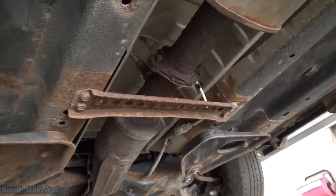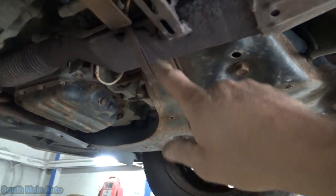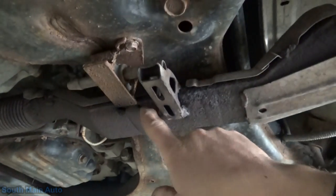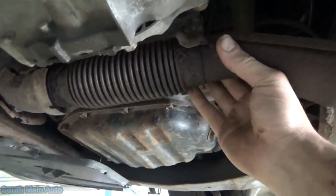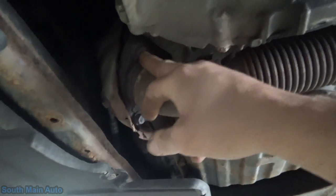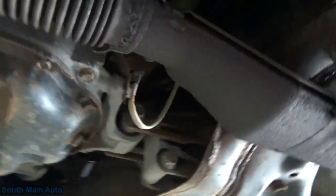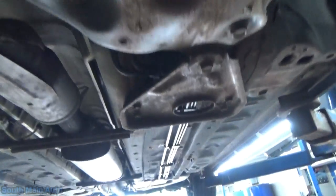So here is the converter - here's the pipe I was telling you about. This is flattened right out and you can see it's all rotted out right through here, super thin. One of the bands off the heat shields but it's all cracked down through here. The flex pipe at some point is gonna give up the ghost. We've got to unbolt it - this is a potentially a problem area because it's so rusty. We have one oxygen sensor here and another one ahead of the converter - both are also potential problems.